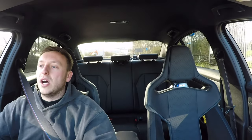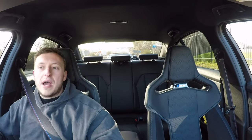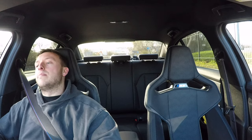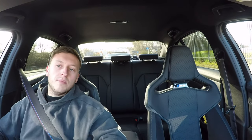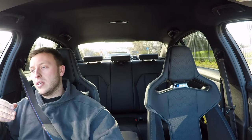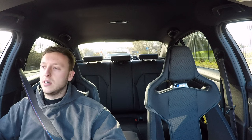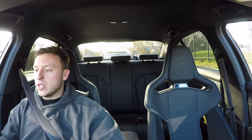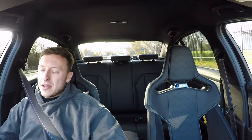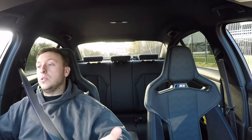The brakes are so good — the tires actually slip. So let's get some temperatures up into the brakes. This is just a little quick road comparison. These brakes are designed for a racetrack — the cold braking performance is pretty much just a step under OEM. It's kind of like carbon ceramic: initially not a great deal of bite, but once you get up to temperature it will throw you forward. The more heat you get through them, they actually get better.